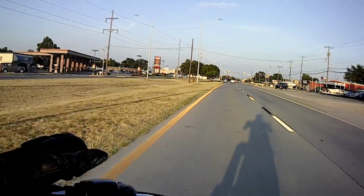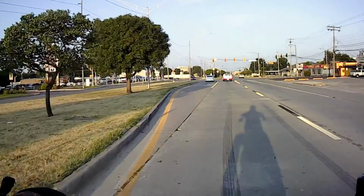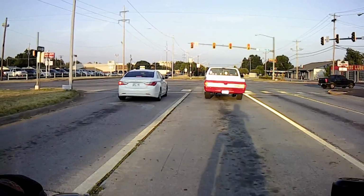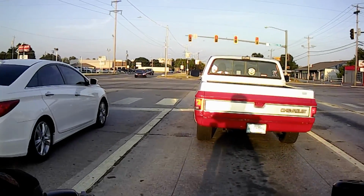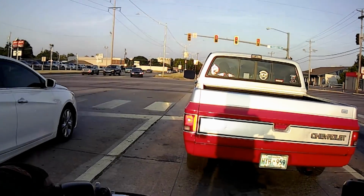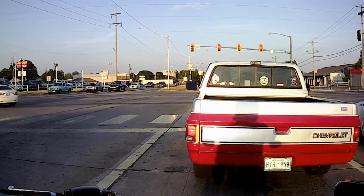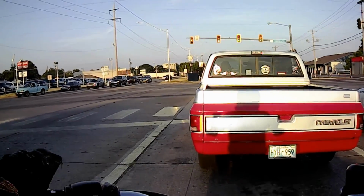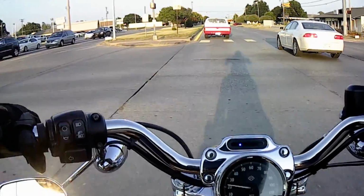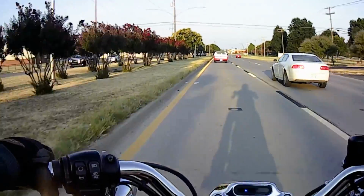kind of to what I said about just doing the pistons and the cams, I had actually watched a video that a Harley-Davidson dealer had posted where they took a customer's bike and did the 585 camshafts with the springs, and then he had a Screaming Eagle air cleaner and the Screaming Eagle Street Cannon mufflers, and the bike was tuned with the Screaming Eagle Pro Street Tuner, and the bike cracked off 85 horsepower. I'm like, what? Of course, they didn't say what RPM it was at, but I'm pretty sure that's going to be up around 7,000 RPM.